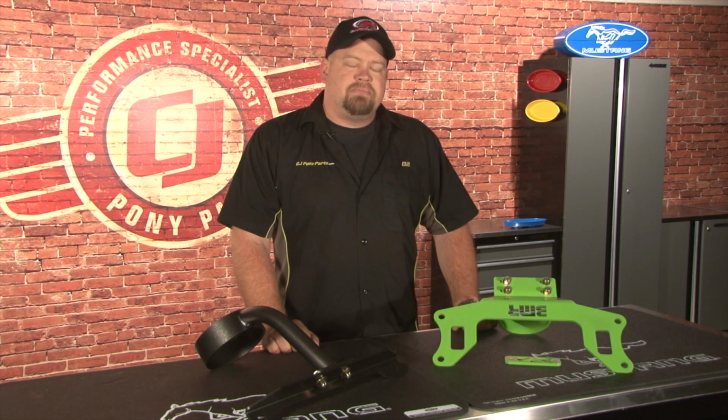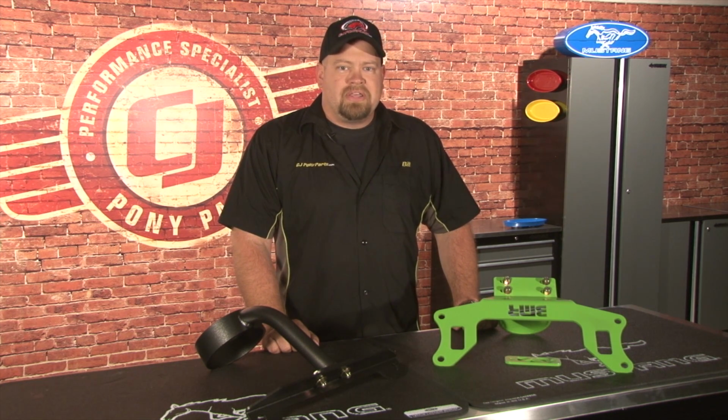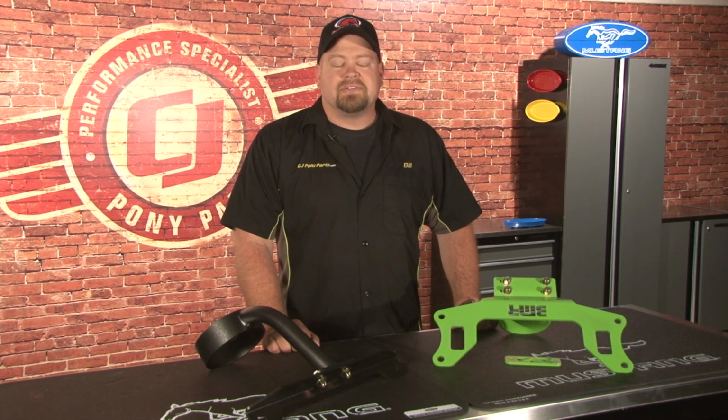The loop is designed to keep your driveshaft in your vehicle in the event of a failure. If either U-joint lets go, the driveshaft will break free and can cause the vehicle to pole vault, causing serious damage. The loop will keep the driveshaft attached to the vehicle to prevent any kind of accidents.